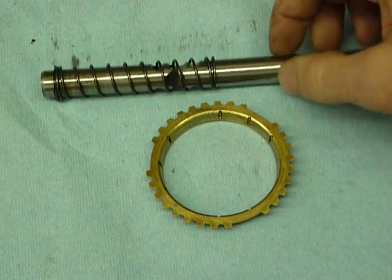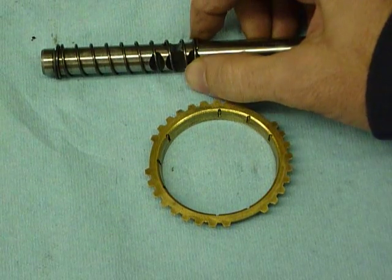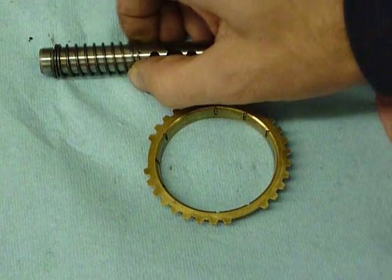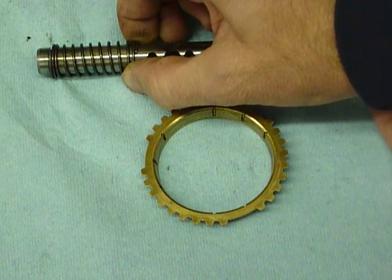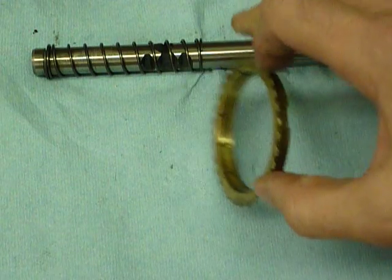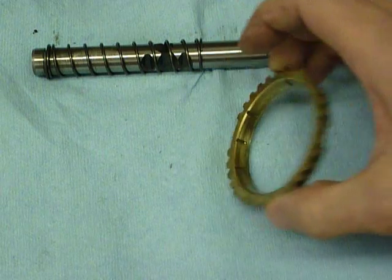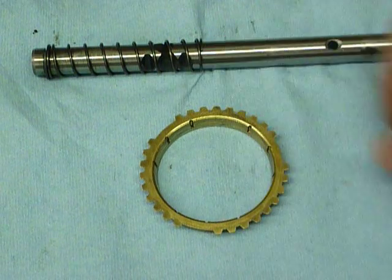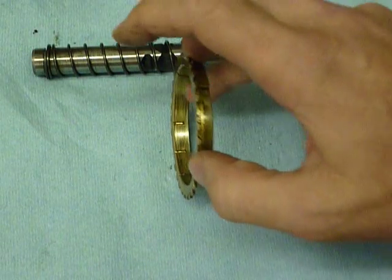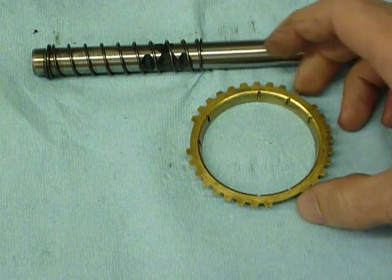Why is this happening? It's happening merely because of the presence of this spring itself. At installed height, this spring has quite a bit of preload, and that is essentially causing this cone clutch to be ridden against the reverse gear a lot of the time. So that is to say, this effect is not caused by operator error or anything that the operator is doing.